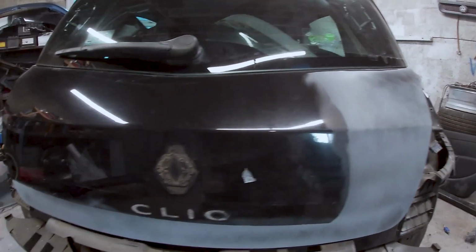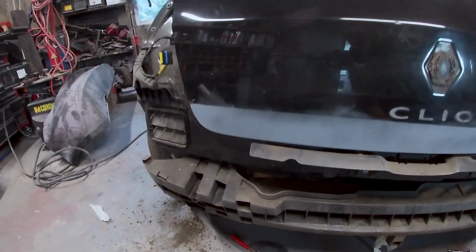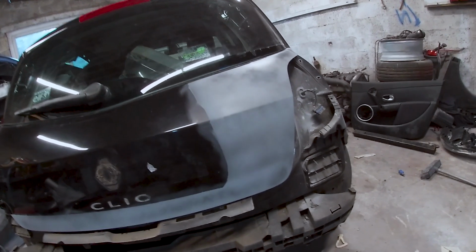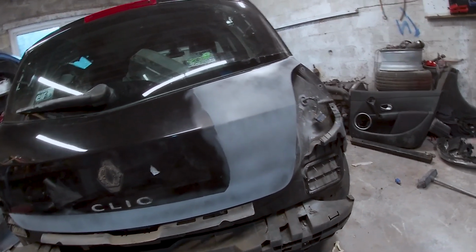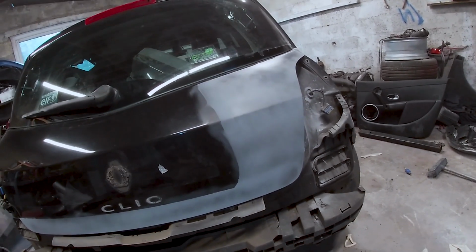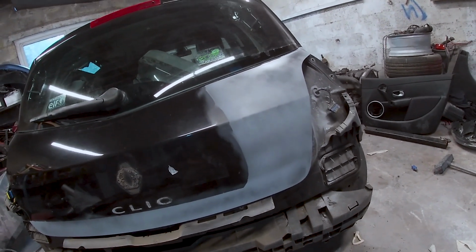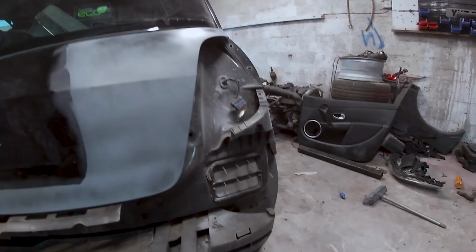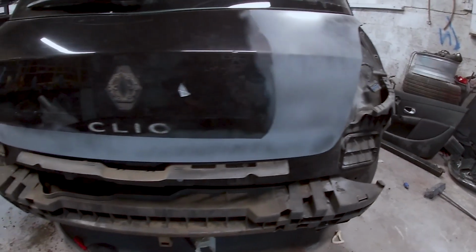So we have it, guys, have the bumper all off, looking good. So it is, have that all primed. And now in the next video we're going to be rubbing that with 320 and then DA around it with 500, just so when we go to paint. Though black you can get away with that with black. The only thing is you have to make sure your repair's right with black. That's the only difference. Now lucky enough I never found any more broken parts underneath, which I'm thankful of.